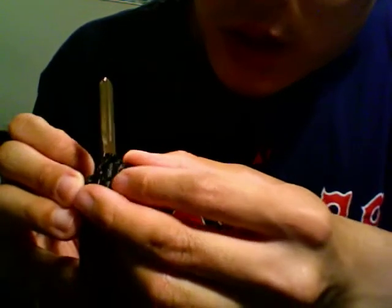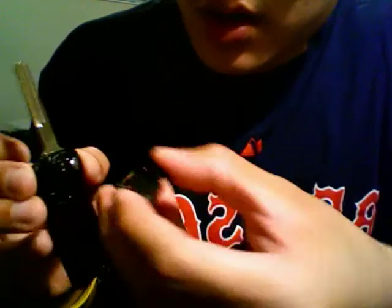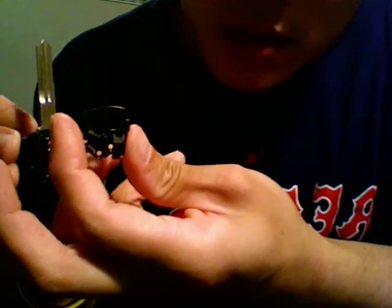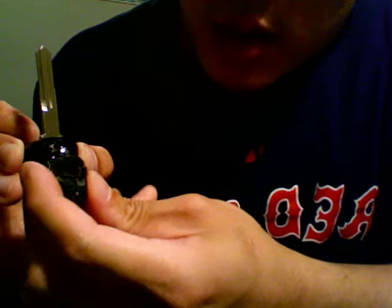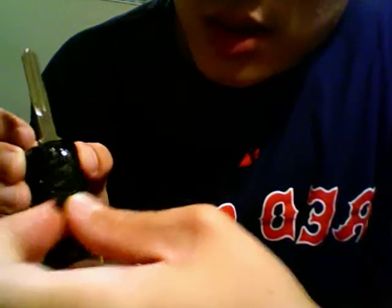Okay. So you're going to take it off. There's going to be a little piece of the spring right here that's grabbing onto that base plate. Remove it from the hole, slide it out. Remember the orientation. So this was like this. It's facing this way. And as it was spinning, it spun counterclockwise, so it ended up like this. So when you put it back on, you're going to put it on like this. Put it over the knob, spin it backwards.